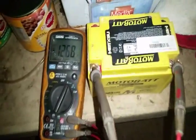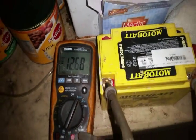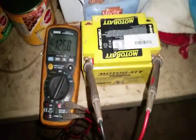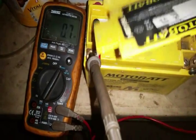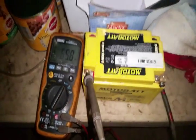This battery has been sitting all day after my start this morning and we are still holding at 12.7 volts. I reckon this battery has been revived — I'm really wrapped with that. I don't know if it was the Epsom salts or maybe just the water. All I'm going to do now is glue the cap back down, chuck it in the bike, and I'm good to go. Thanks for listening.